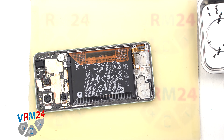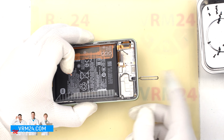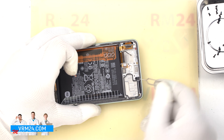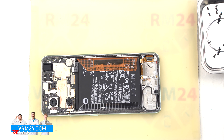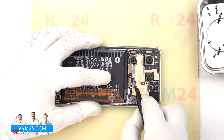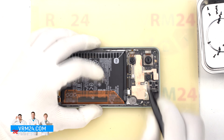Now a quick test of the microphone hole. The microphone hole is located in the display frame and has an L-shape — the hole goes to the subboard, and the microphone itself is located on the back side of the microphone hole. Respectively, if we insert something into the microphone hole, we simply can't damage the microphone that way. But water can.